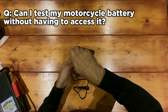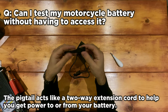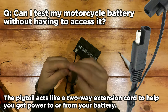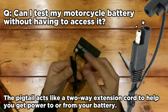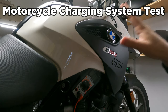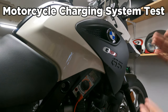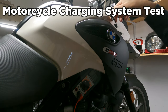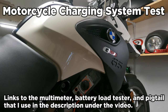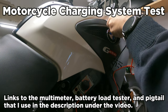If you're too lazy to access your motorcycle battery, there's another way. If your bike has a battery tender pigtail, it allows you to plug in and charge your battery or connect accessories, and it has a positive and negative terminal you can use for testing. Multimeters are super useful and only about $15 to $20 — I strongly recommend grabbing one because they come in so handy.